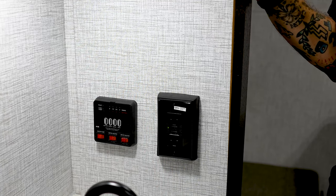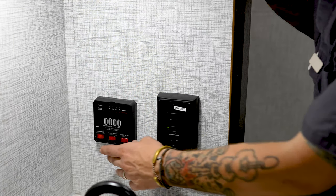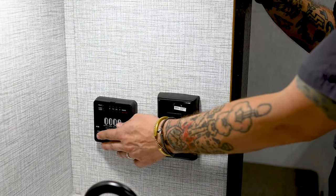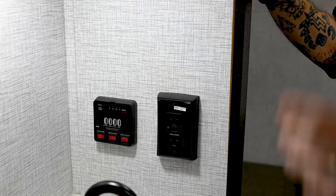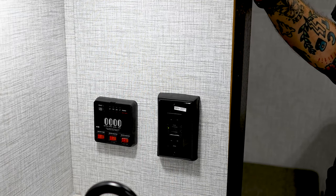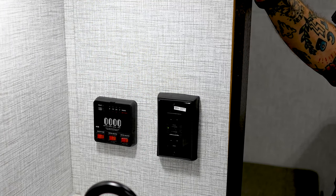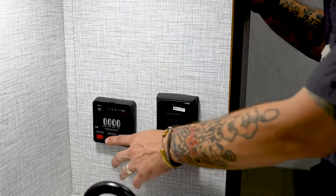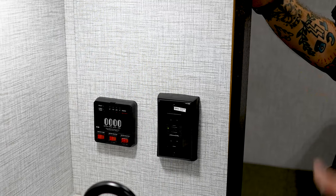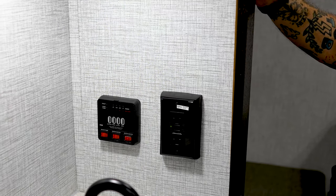Down below that, we have our water pump switch. These will be lighted switches, so they'll indicate with the light that they are on. The water pump is going to be for off-grid or boondocking — it will pressurize that freshwater system and draw that water up to the fixture to make it usable. We also have our two water heater sources: one being propane gas, geared towards the off-grid scenario, and then we have a 110-volt heating element that is going to be utilized in the capacity of an RV park. If you want the most availability to hot water or the quickest recharge rate, feel free to use both sources — that's going to clock you in at about 17 gallons per hour. In terms of efficiency, propane gas is generally about 14 gallons per hour, and electricity comes in at about 11 gallons per hour.